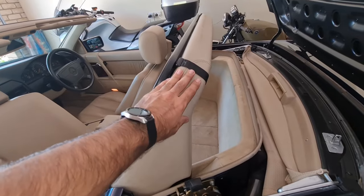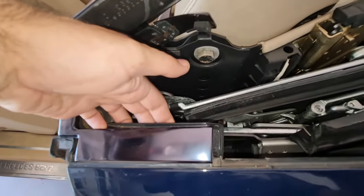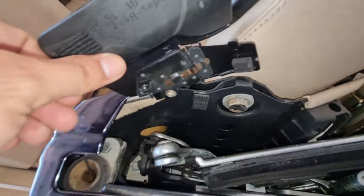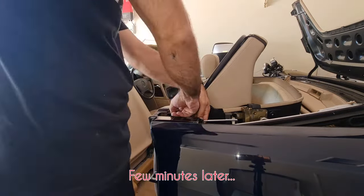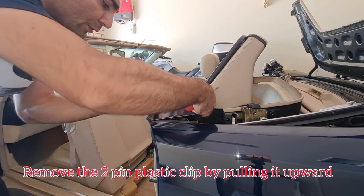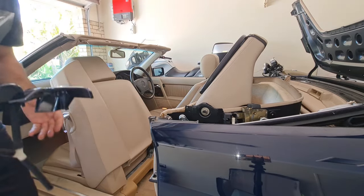This makes your job way easier. To begin, we have to lift the roller bar so we can access this panel area over here. The first thing to remove is three Phillips screws from around this cover. We have two screws underneath here — one, two, and the third one over here. Let's remove this and we will continue. Let's remove this plastic and then you'll be good to take off the cover. Make sure not to lose this rubber lock.